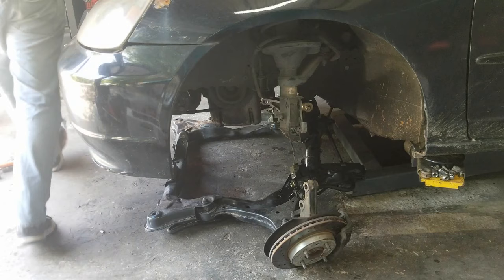I'm going to get our transmission lines off — get a drain pan under there to catch any fluid that may fall. I just took those hoses up by the radiator fan to keep them out of the way. Now I'm going to get a jack stand and put it up under the motor, set the car down a little bit so the jack stand is supporting the engine. Then we'll use the floor jack and put it up under the transmission, disconnect all the bolts for the transmission, and then set it down.